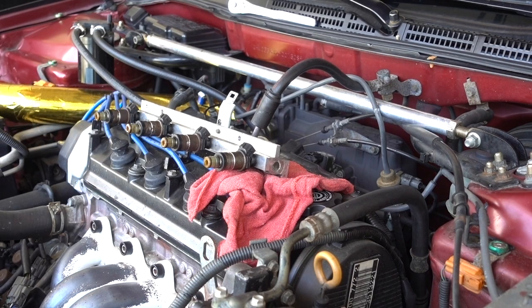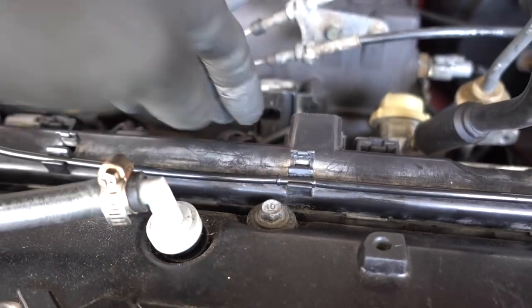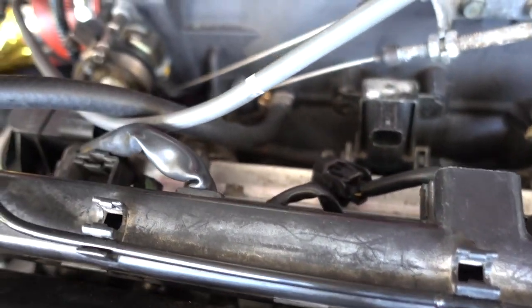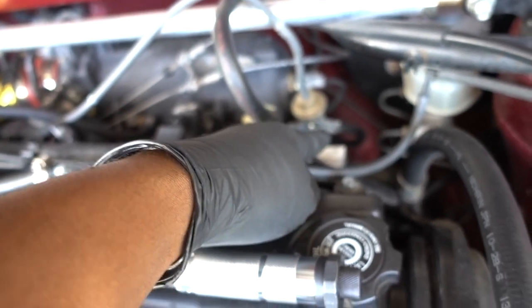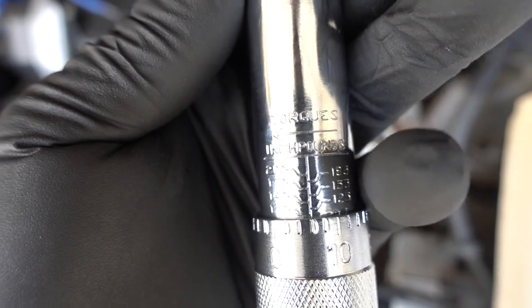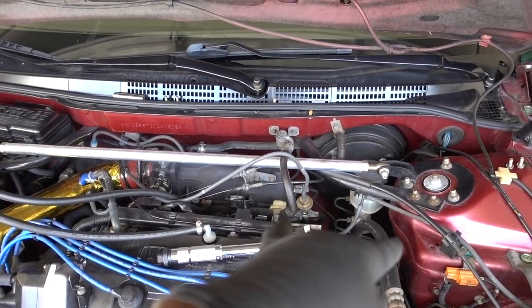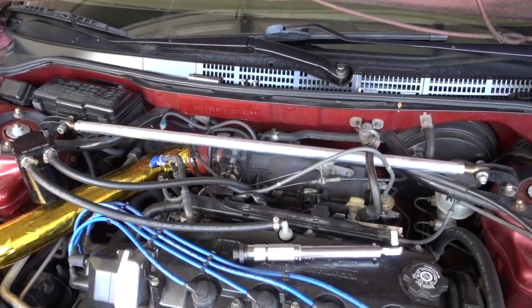Now we can put the rail back into its place. To put the rail back on, it was easy for me to remove this one so I have more room. The rail is on. You're going to see the bolts — for the rail, you're going to have to torque this down to 102 inch-pound, not foot-pound. 102 inch-pound for those two. For the fuel pressure regulator bolts, they're going to be torqued down to 108 inch-pound. I have my small torque wrench set at 102 inch-pound to torque down those two, then I'm going for those to 108 inch-pound. Once you torque down those bolts, make sure that you plug in your injectors, connect your EGR — everything that you disconnected, put it back on.